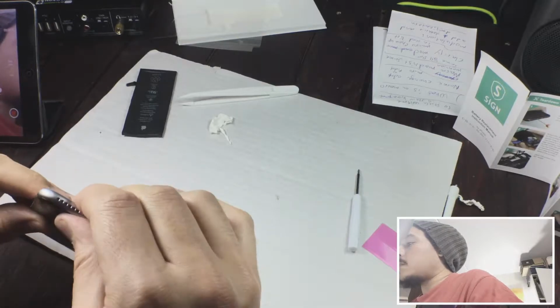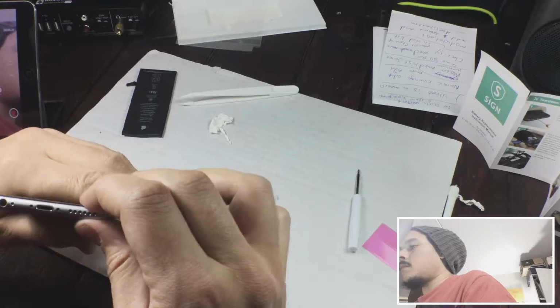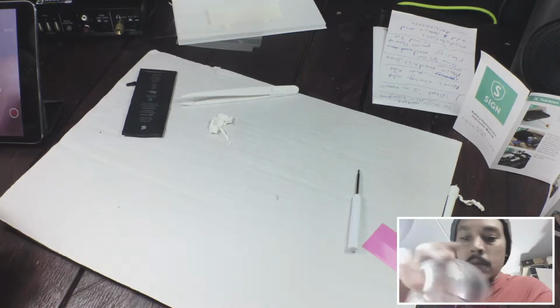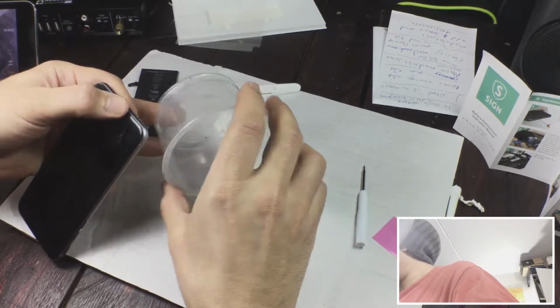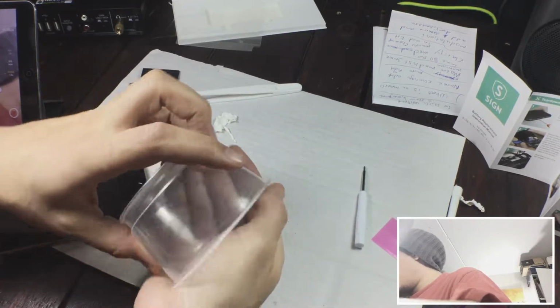And remember now that if you're doing this on a water protected device, as soon as you remove your screen, you're destroying the adhesive strip holding the screen against the chassis. So you're literally destroying the waterproofing. Okay, so it's no longer waterproof. You can get moisture in there. I don't know how Apple does it if you send it into them, if they properly do that.